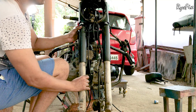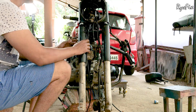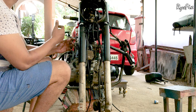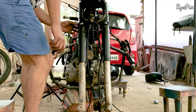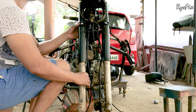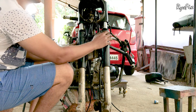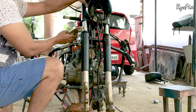As I mentioned before the video started, the tire and mudguard must already be removed — I have a separate video on that which I will link in the end screens. As you can see there is no tire or mudguard on this bike because I removed them first. The next thing you will have to do is pull down the fork assembly a little bit. Take a vice plier, hold the shock absorber, and rotate it to unscrew it from the casing.